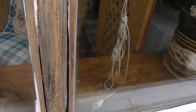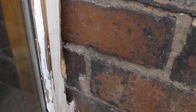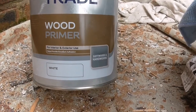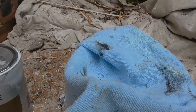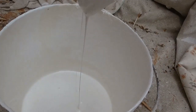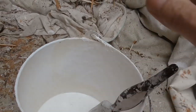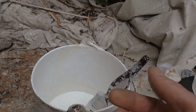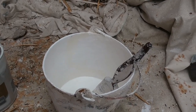What I'm going to do now is put some oil primer all over the wood. That's the primer I'm using - it's for softwoods and hardwoods. Always note the consistency of it - it's quite watery, quite thin, and that's what you want. It really does soak into the wood. It stays slightly tacky until the undercoat goes on and then it dries off nice.